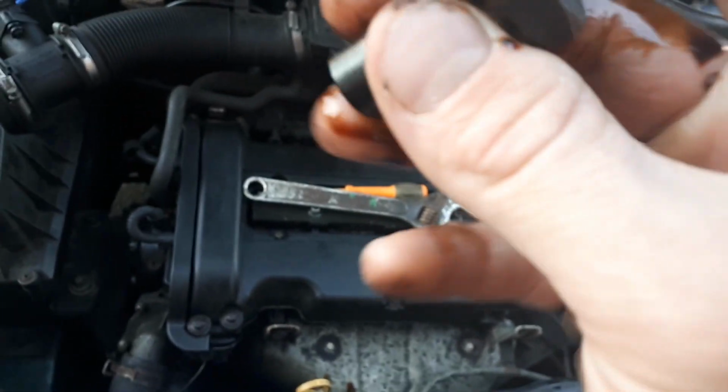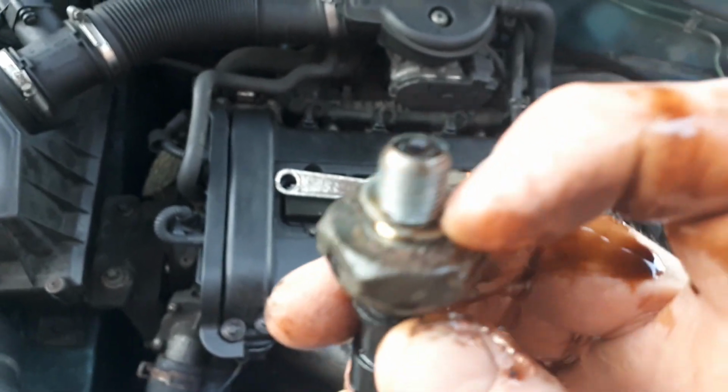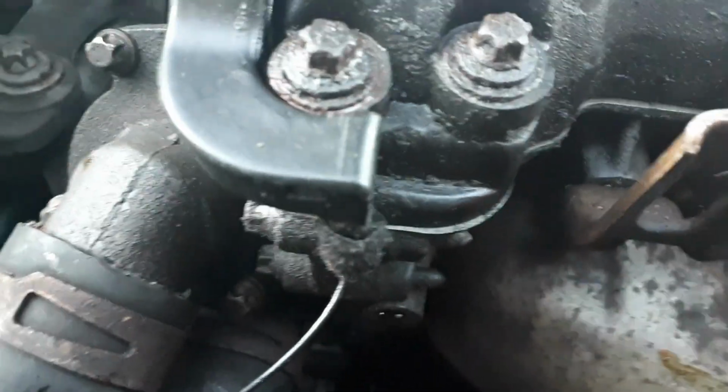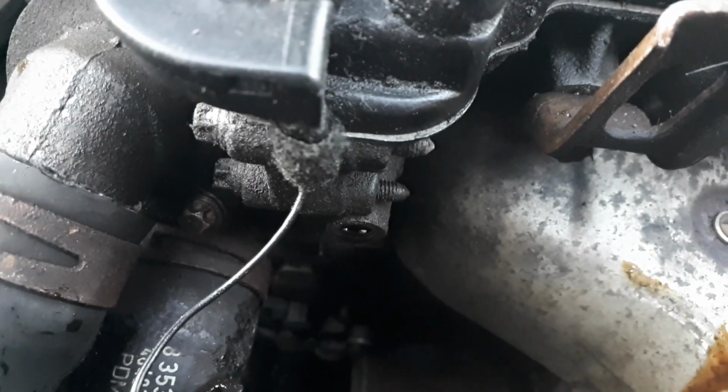But it's at this point where you get your new switch. Check the new O-ring comes with it, that little washer there. Washer, should I say. And you'll clean all these surfaces up. Well, it will be clean. This will be your new switch. I'm just showing you this for the video, so check that this edge here is nice and clean, so it makes a good seal and doesn't leak. I'm just going to tidy this back up now and get the new switch on.